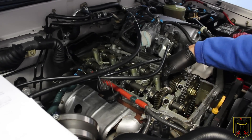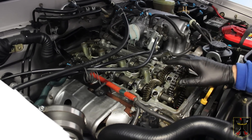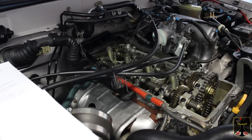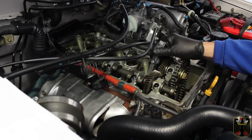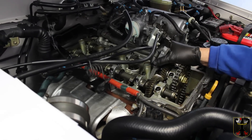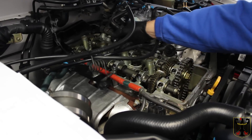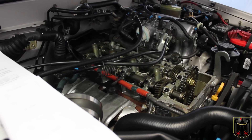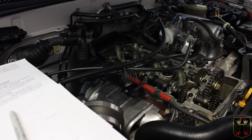These are your two timing gears and there are dots on the back of these when you're at top dead center — you have to look on the back to see them. In this position, cylinder number three here is at top dead center. We can check the exhaust valves for these; the minimum has to be 0.010 and that feeler gauge easily slides between the cam lobe and the shim. We were worried about the valves being too tight after all these years of driving, and they're definitely not.